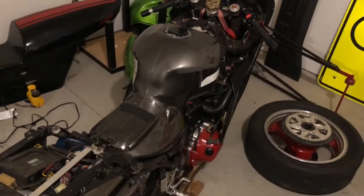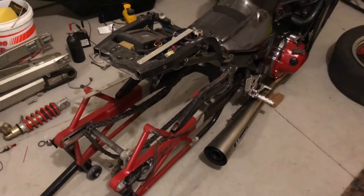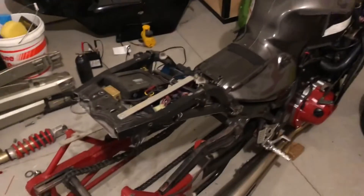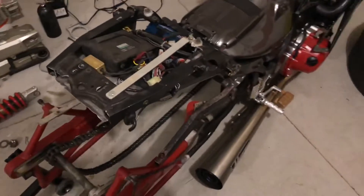As you can see I've got it pretty well torn apart. I haven't really done anything too special on it so far. Really all I've done was take the old big one-piece fairing off of it and got the air compressor taken out that just pressurized the air shifter. The air shifters don't use all that much air for each race so it's almost pointless to have the air compressor. I know a lot of people actually use CO2 for air shifters, so I'm probably going to be doing that.